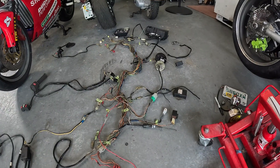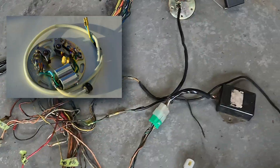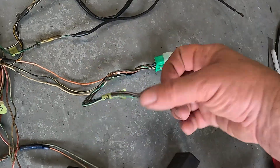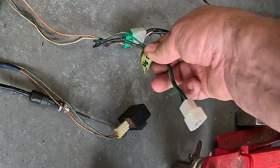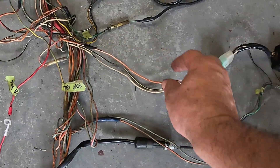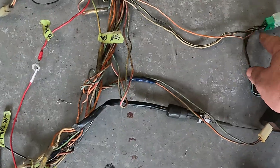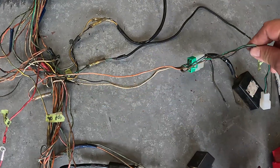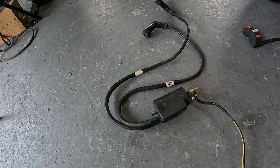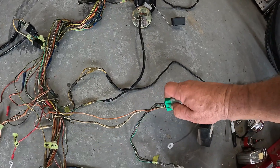Your donor bike may have a CDI (capacitor discharge ignition) or it may have points. This one originally had points but someone converted to CDI, so it'll have a CDI box that tells the plug when to fire. That can be removed — we don't need it. It'll have wires going into the engine to a pulse sensor on the crankshaft or magneto flywheel for timing. There's an orange wire going in because it's DC-fired — storing 12V DC, then releasing it to the coils. You might have one to four coils, but we don't need them. Get rid of the coils — and the CDI box — trash.